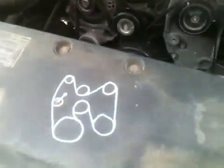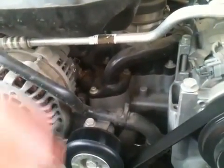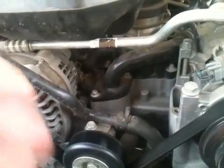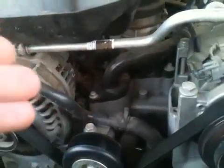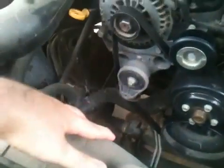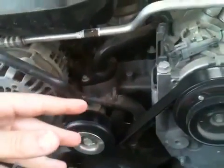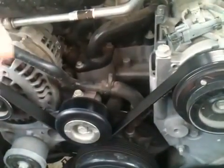This fixes the issue on a 2008 Silverado work truck. What happens is the thermostat fails and opens too early, which trips a code in the computer. It says the computer doesn't trust the temperature sending unit because after a certain length of time the motor should have heated up to operating temperature. Since it doesn't trust the sending unit any longer, it turns the electric fans on high and turns off the air conditioner to reduce cooling load on the motor so you won't overheat. The problem is you're not actually overheating.